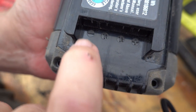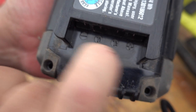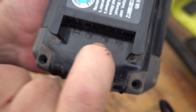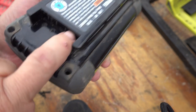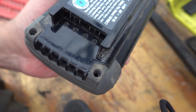There are four contacts in this battery: there's the minus, the plus, and then T1 and T2. T1 and T2 are the thermal sensor — that says the battery's getting too hot. And the plus and minus are the two power legs. I'm betting if I put a meter on there, I'm going to get full voltage across those two, or something approaching a full voltage. Maybe we should try that.